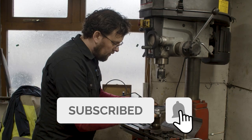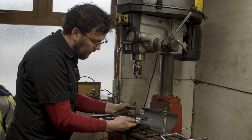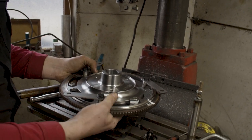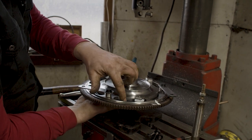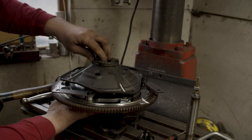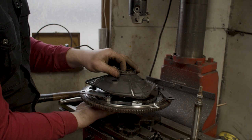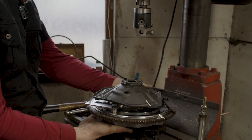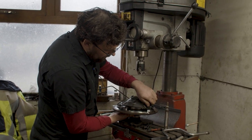I've put my primary gear on here just to help me get the clutch plate set up — it centers the clutch plate for me. So I have my pressure plate, my clutch plate, and then I'm going to put my flywheel down. That's just centralizing everything for me. The flywheel sits on the nose of the crank, the pressure plate is sitting centrally on the flywheel, and then we can put our diaphragm on. I've marked it up from when I assembled it — three white marks that I use to line everything up to make sure I keep everything in the same order.